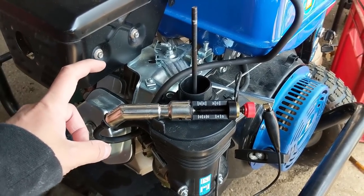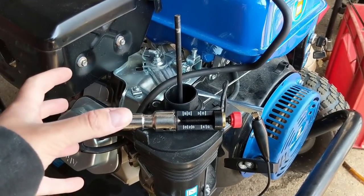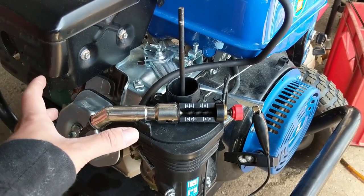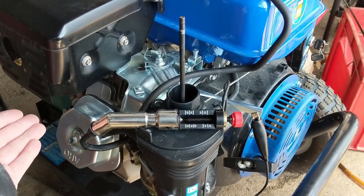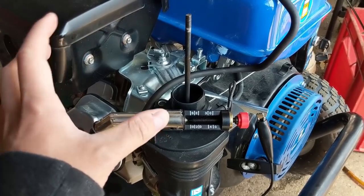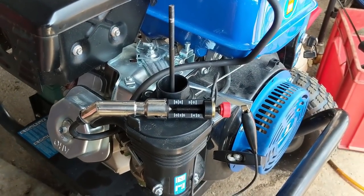What you're supposed to do is remove the plug and spray engine fogging oil in, then pull the engine over once by hand to lubricate everything. On many newer engines the block is aluminum, but the cylinder sleeve the piston rides on is steel. The piston itself is aluminum but the piston rings are steel, and those steel rings can seize to the steel sleeve inside the cylinder.